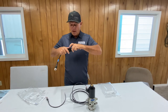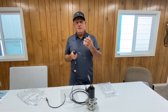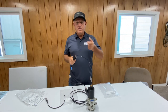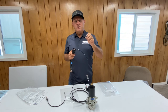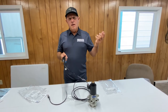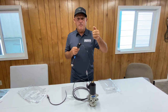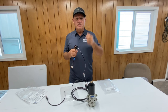When you're ready to operate, plug it into the attachment. When you turn the machine on — you don't even need it running, just key on — look here and see if this is flashing. That tells you there's power and it's connected to the bus. When you touch what we call B1/B2 — the little paddle closest to your left thigh with a picture of two opposing solenoids — touching it at the top locks it on; touching it at the bottom is momentary. If you lock it on, you can touch either button and it'll cancel out and go back to non-operational. You can operate this using the paddle on the right side, which makes your pump go forward or reverse. If you touch the top, it locks on so you can take your hand off and still operate it; to reset, just touch it again.